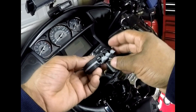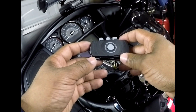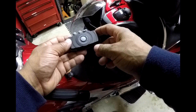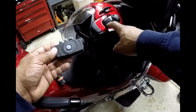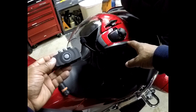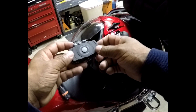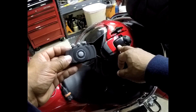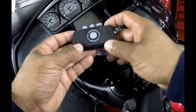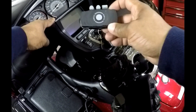Here's how the SM10 works and what it does. Basically, my SM10 is a wireless Bluetooth transmitter. It will allow me to transmit audio from a Honda Goldwing over to my Bluetooth helmet. You can have a Sena 20S, a Sena SMH10, or any non-Sena Bluetooth. The SM10 will connect to any wireless Bluetooth helmet. The way the SM10 works is that you have to get audio from your motorcycle into the SM10.